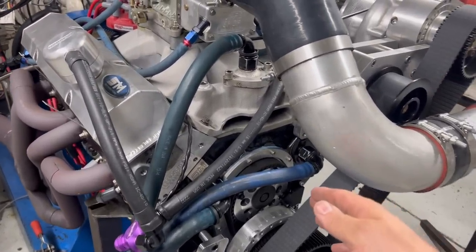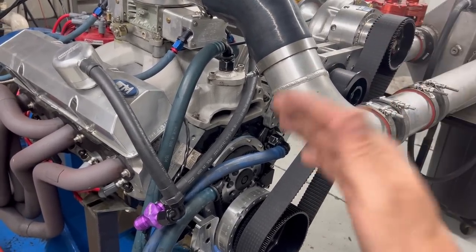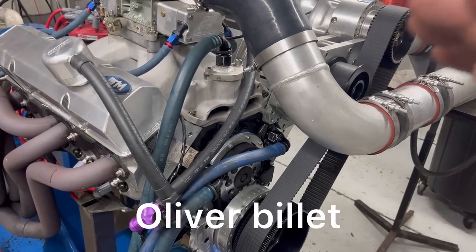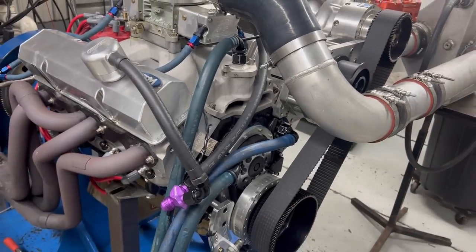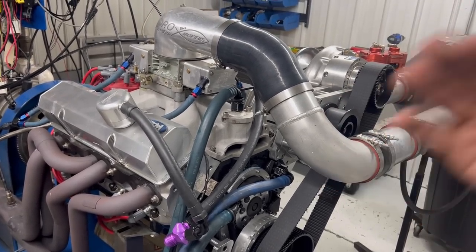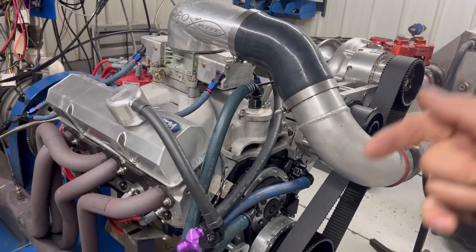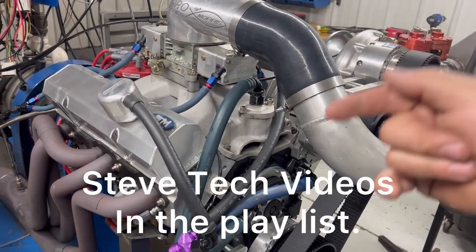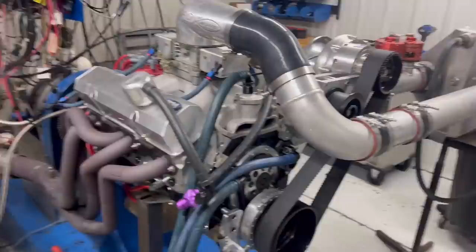This thing still has a steel rod — three and three-quarter inch stroke with a six-inch steel rod in it. And then our piston package: we do all of our custom piston packages the same. They're all hard anodized and they all have an AP steel ring pack in them. Steel rings — I don't run zero gaps. If you ever want to figure out why I don't want to do a zero gap ring, go to my Steve Tech videos on piston ring design and you'll see why.